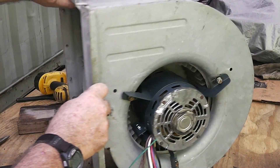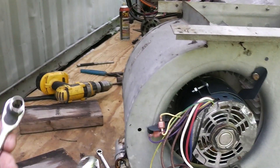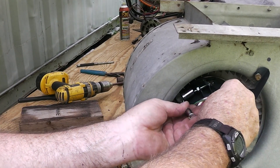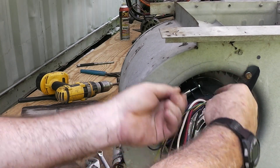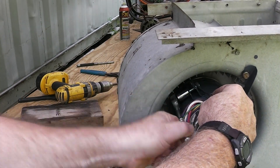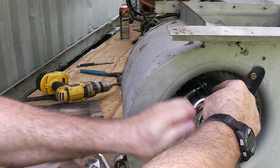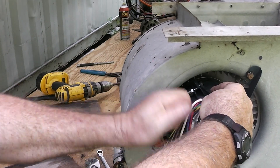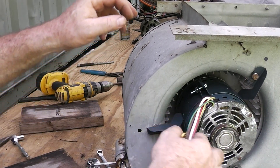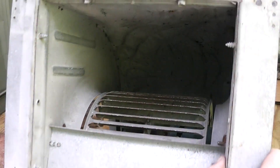See how smooth that works right there - that's where we want to tighten it up. Let's get a wrench and tighten that up. This is 3/8ths on this side and 7/16ths on this side. You don't want to make it so tight that it deforms the metal right there - you want it nice and snug. Make sure our flywheel is still centered.